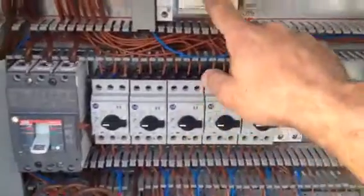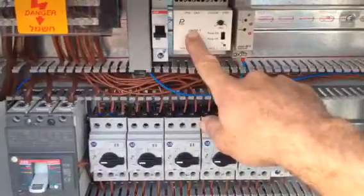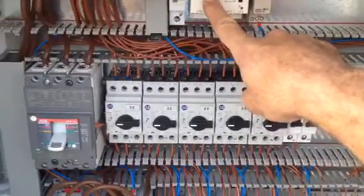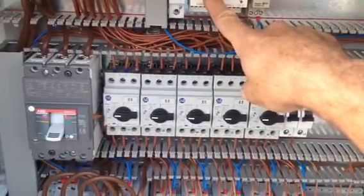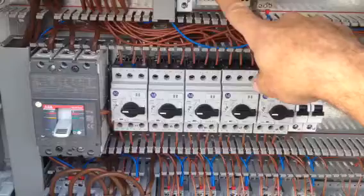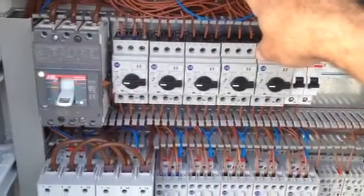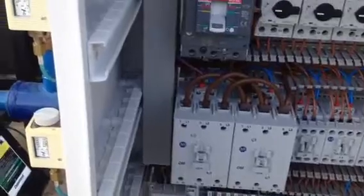This right here is for the water electrodes. When the tank gets empty, the mixer that mixes up the water will shut off and the unit will shut off. When the tank fills up, the mixer turns on and the unit turns on — no sense in the thing working while there's no water in the tank.